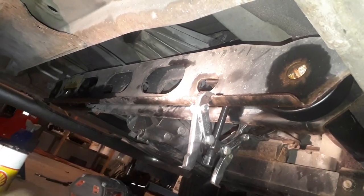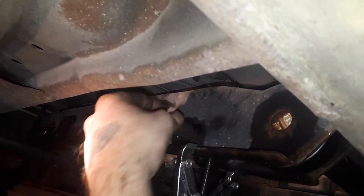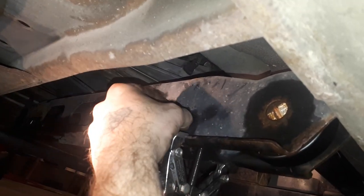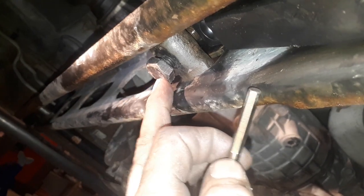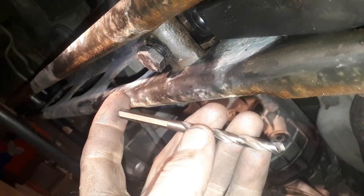Tighten that puller up a bunch — enough that that keeper will go in there. So I pulled off the gear puller now. I'm doing the setup on this bolt which kind of preloads the torsion key, and all this is is a drill bit. It doesn't really matter what you use.